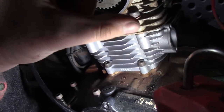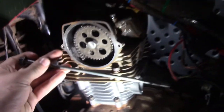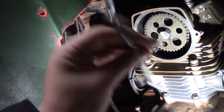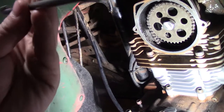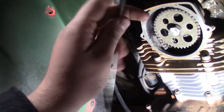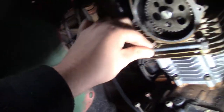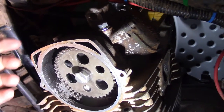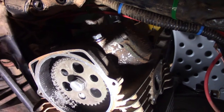There is a chart that will tell you bolt sizes and torque. Head bolts are a little bit different, especially these that are super long. You have to think about this head bolt being that long. These are very specific: a 17 foot-pound torque. These should be able to handle 20, but they won't. If you try to torque these to 20, you will snap them. So 17 is as high as you can go. They may go to 20, but they're going to have a lot of deflection, and it's probably going to stretch the bolt a lot.